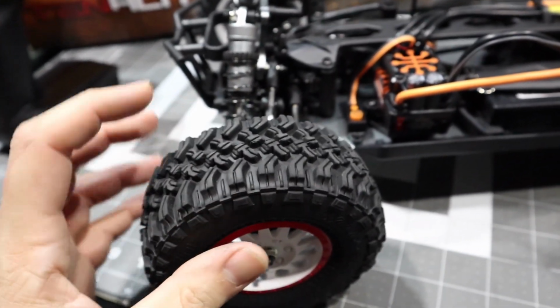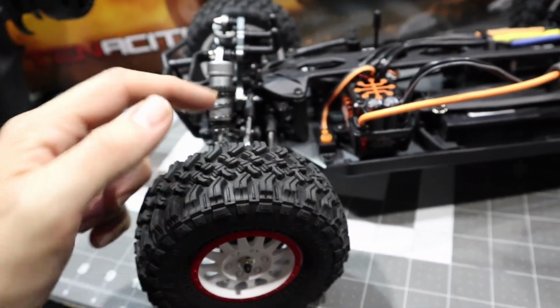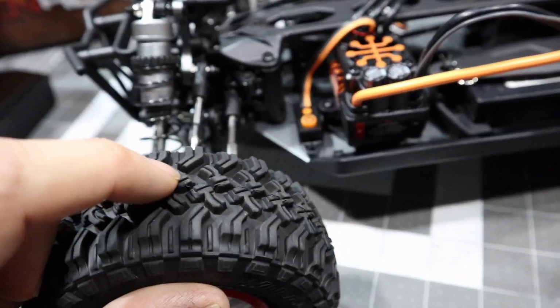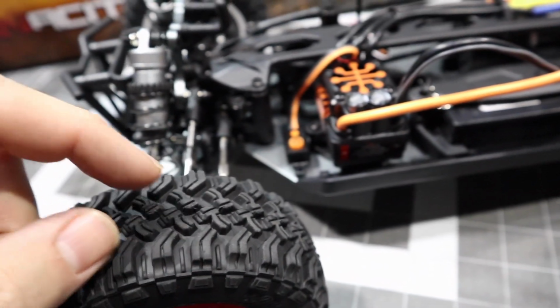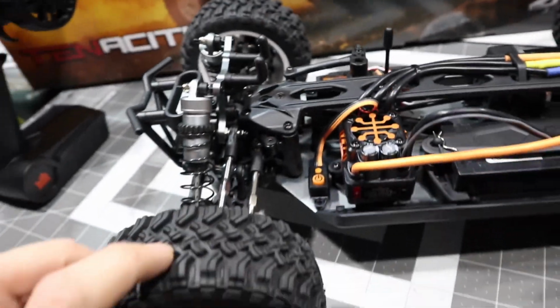It's counterintuitive, guys, but seriously, poke holes in your tires because water gets in and it can't get out, and that destroys axles, it destroys wheels, everything. So poke little holes in. You can either use a body reamer or a drill bit. I prefer the body reamer method as of recently, or you can use an X-Acto knife and just make a slit. You can have it every 180 or every 90. That just lets the water fling out.